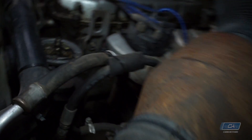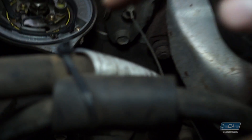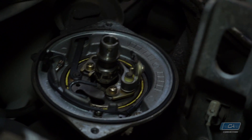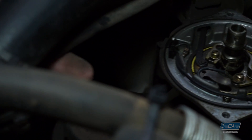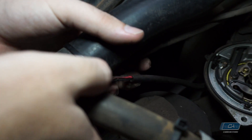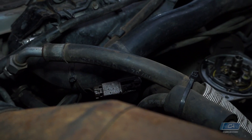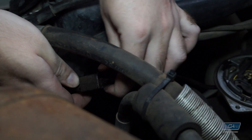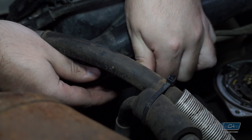We'll bring the camera around and just follow the wiring from the original. This is the factory harness — a little bit greased up. We're running our own wiring to the coil, so we're just going to disconnect this plug altogether, which means we don't need it.